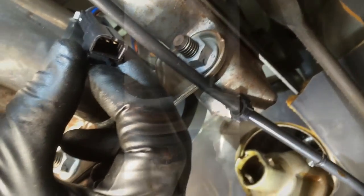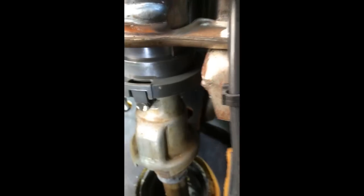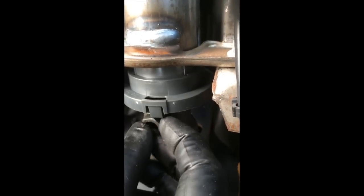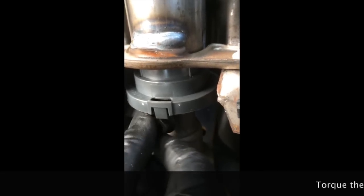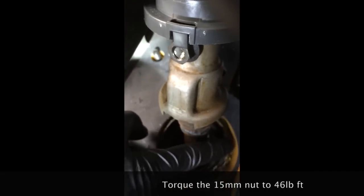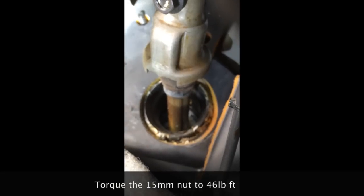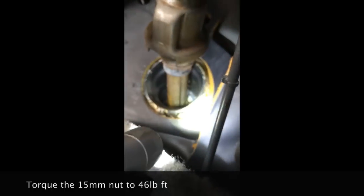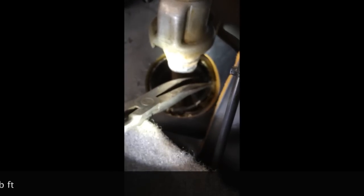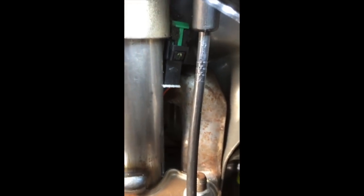Let's take a look under the hood to see why we did all this. We've got this back on here. The last thing we need to do is position our nut on the bolt and tighten it back up. I noticed that when we pushed this coupler back into the firewall, we had inadvertently moved our firewall seal. It's very important that that stay in position — that's what's keeping water and heat from coming into the cab. If you accidentally push it through, use a pair of long nose pliers to pull it forward. The little notch goes on the bottom. We've also reconnected the harness connection and reinstalled the green retaining clip.